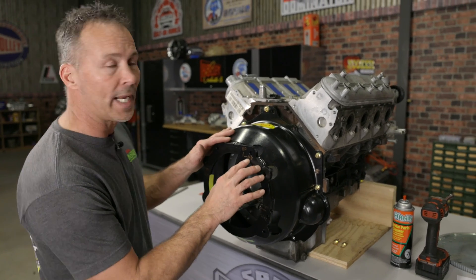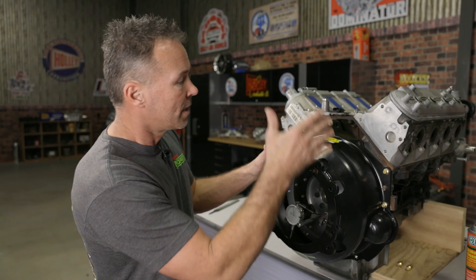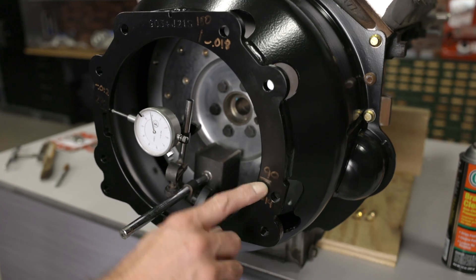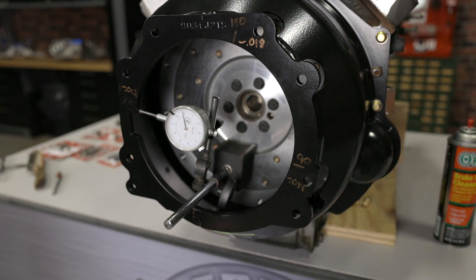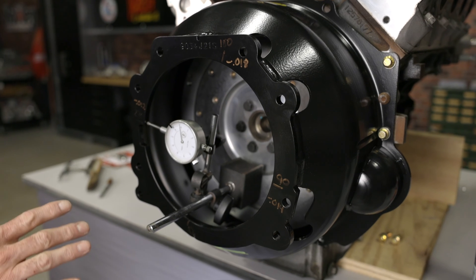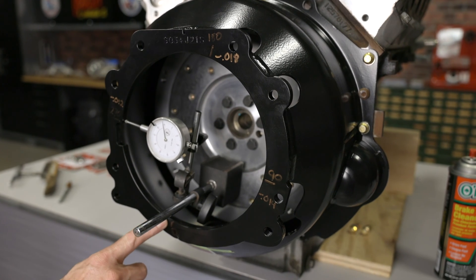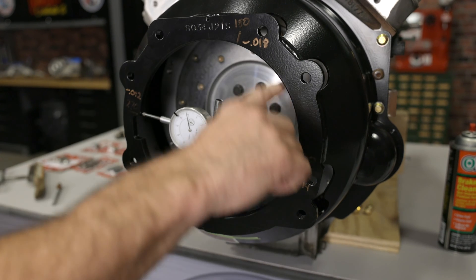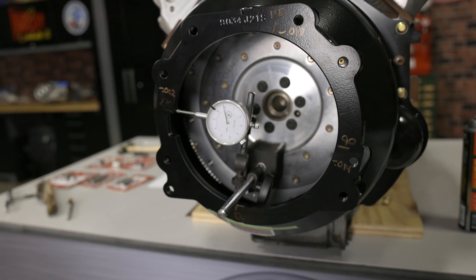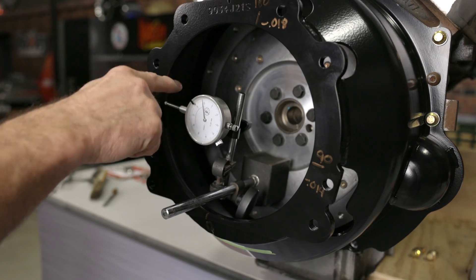The measurement recorded at the 180-degree mark will help us determine what offset dowels we'll need. Remember, using this method, the bell housing has to move towards the zero mark to bring it back within spec. The readings at the 90 and 270 degree marks should be within five thousandths of each other, and they confirm the direction we need to move the bell housing. If these two readings are out of spec, either the mark at the zero location was not actually the highest reading, or your bell housing hole is not symmetrical. Recheck the zero mark by rotating the crank several times and confirm or move your zero mark, then start over. If your zero mark checks out, more than likely the hole itself is out of round. QuickTime offers an indexing plate that works with select bell housings to provide a true circle for indexing purposes.